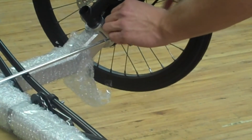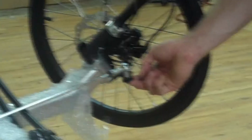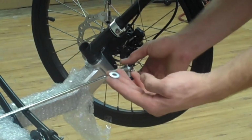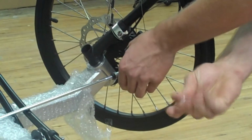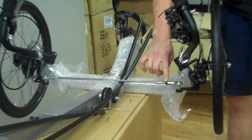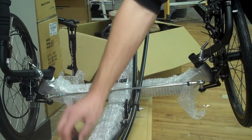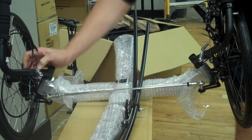If it's stiff and won't go through, just thread it in as if you're twisting it into a nut. Put on the thick plastic washer, followed by the thick metal washer, and then the nylon lock nut. Make sure that both chain tubes are running underneath the tie rod. Once you've completed the headsets, you can put on the finishing caps. Those just slip into the hole in the top.